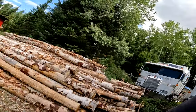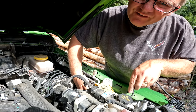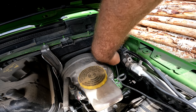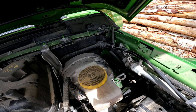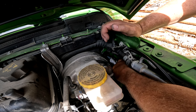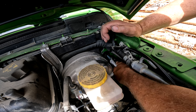And I found a plug that goes through the firewall right down there. So, I don't know if I can drill through it where it's at to put my plug through, or I might pull that plug out, put a hole in it, and then put it back in. Never been much of a fisherman, but this is definitely fishing. Fishing wires, so they don't get in the way. Not the easiest spot to get into. There we go. All sealed up so we don't get any fumes or noise.